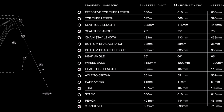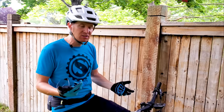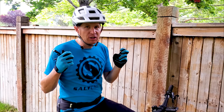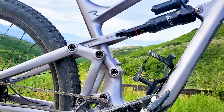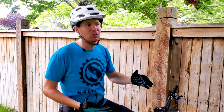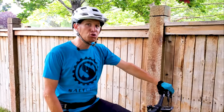Quick refresher on geometry: 66 degree head tube angle, 75 degree seat tube angle. Pretty short wheelbase for how capable this bike is. Often to get a bike that really rides well through chundry trails, it's got a longer wheelbase and more travel. The problem with that for me is on slower speed, cross country or blue-type trails the bike can feel lethargic or dull. This still feels sporty and zippy, but on the big trails the 130 millimeter Canfield Balance Formula suspension doesn't get overwhelmed. It tracks well, soaks up all the bumps, and has a rearward moving axle path — making it feel really buttery smooth, like a hover bike, with a flowy, good feel through chundry sections of trail.